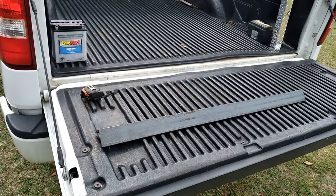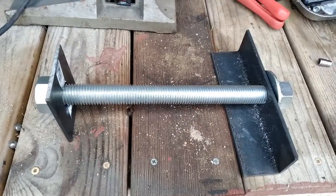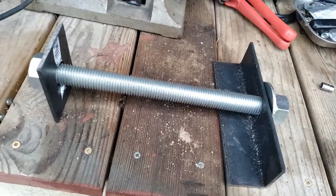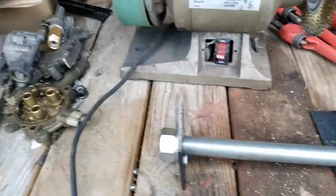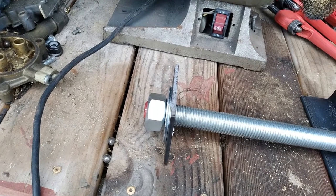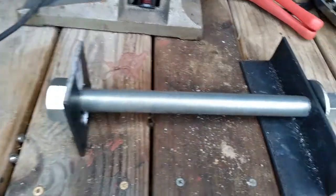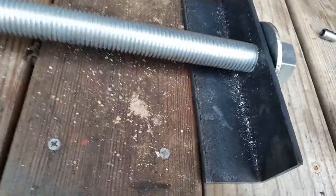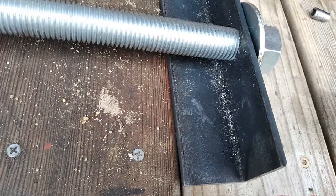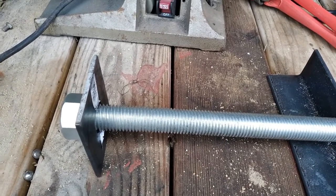Gonna pull the sleeves out of this thing tomorrow when we go over there, so I need to have this ready. Here's our homemade sleeve puller — it's just some piece of angle iron. I made it about 8 inches long. The bottom piece that goes at the bottom of the sleeve is just a leftover piece, I think 2-inch stock I had laying around. The angle iron — I think it's 2-inch or inch and a half maybe. And a piece of 1-inch all-thread I had laying around, so I just used it.